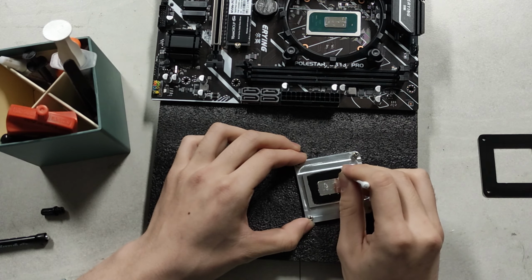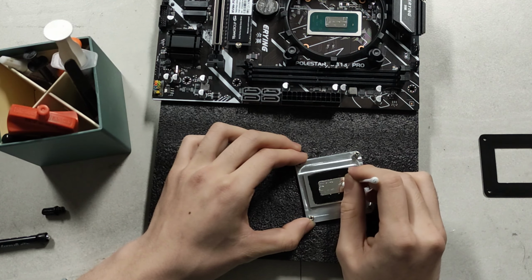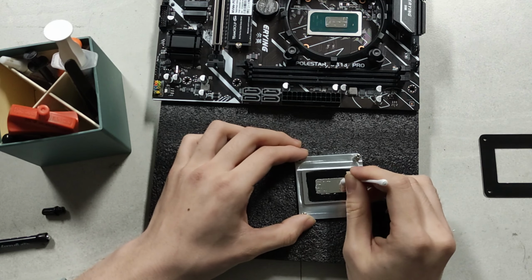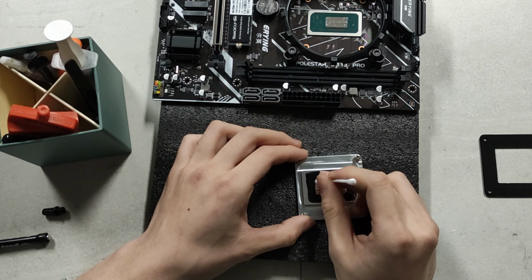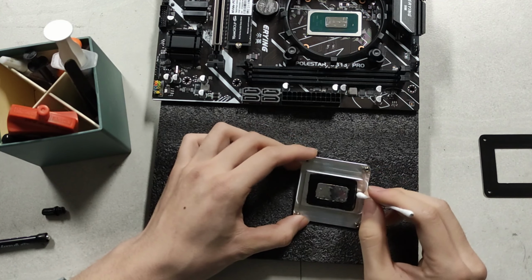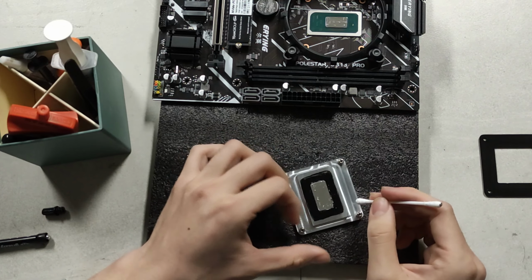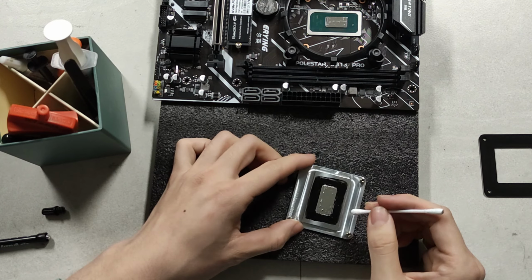And since this is the biggest concern, because the block is made out of aluminium, hence why we are using as little liquid metal as possible and also avoiding any kind of spillage here. That's why we have everything masked off with a layer of nail polish, because this is an aluminium block around the edge. Copper is only in the middle. And clean up any excess, and that's just resting on the bit of nail polish here, so we'll be fine.